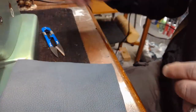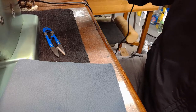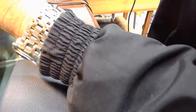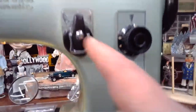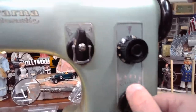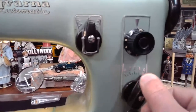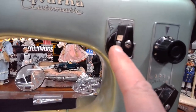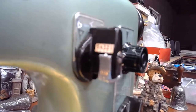Yeah, you could. So I'm going to recalibrate the machine again, taking that stitch width down to 0, and get ready to move us into position 2 on the cam stack. We'll see what kind of stitch that gets us. So all I did was, again, when you're changing between the cam settings on here, you want to take your stitch width down to 0 so that it pulls that finger back away from the cam. And then you move your slider into the next position you want, which I just did. We're going to be doing stitch number 2 now on revised Cam B.